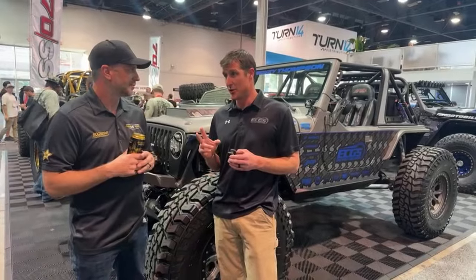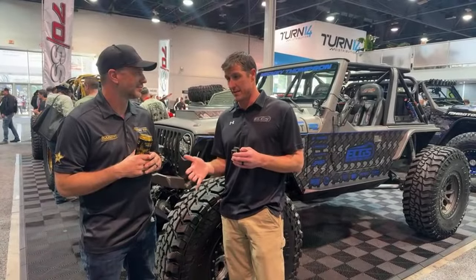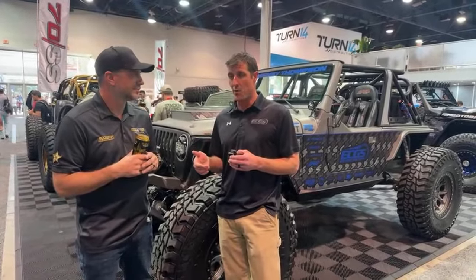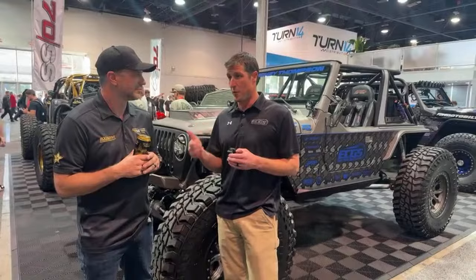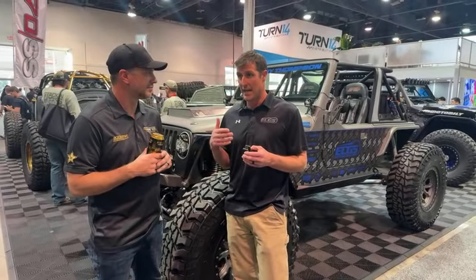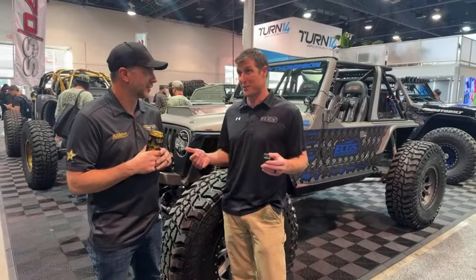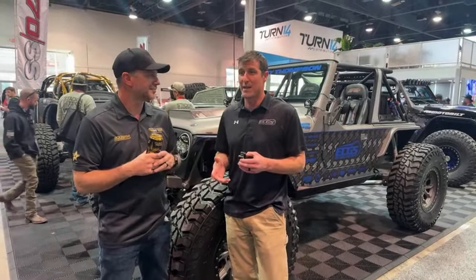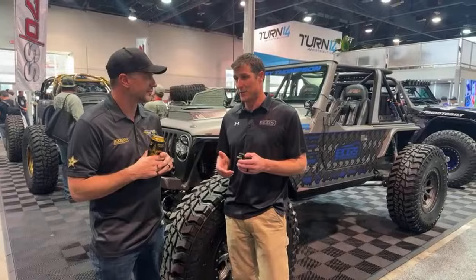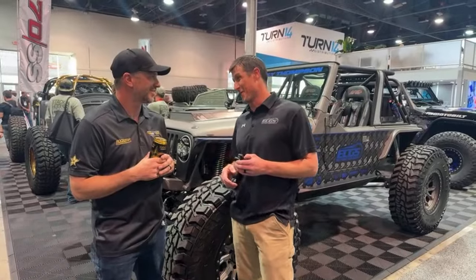Yeah. There's two things: shock loading stuff and beating on it in the woods, so it has to be strong for that reason, shock load strength. But also what I think people don't understand is putting miles on a vehicle is a lot of wear and tear. So when you start getting into a 14 bolt and the 80, big carrier bearings, big ring and pinions, it won't build so much heat when you're running with these huge tires on the street at 80 miles an hour. So everything we've done over the last 15 years is just make everything bigger and better, because that's what people are doing. I mean, 42s is like the new tire size, right? Yeah, 100%. It's not 35s anymore.